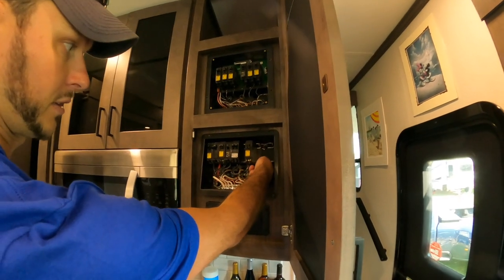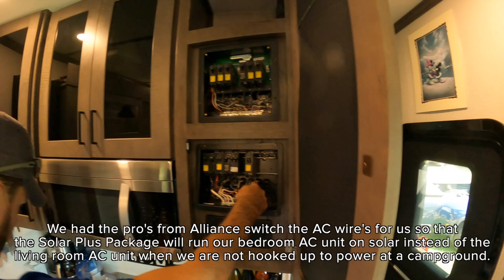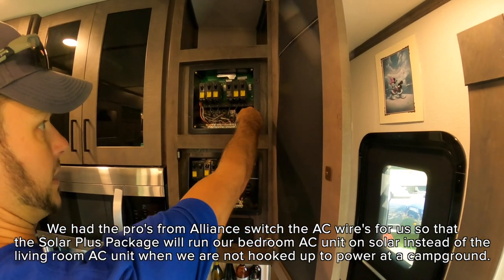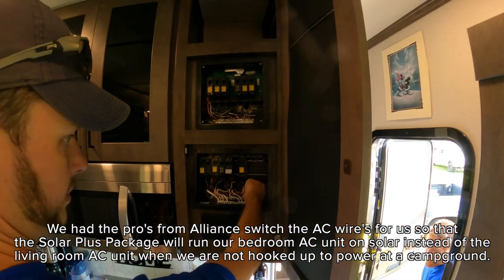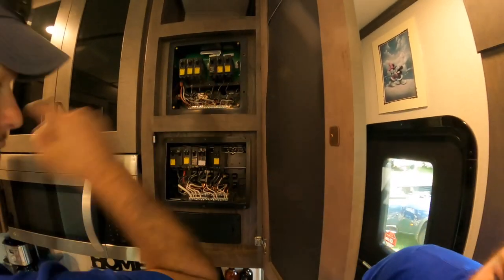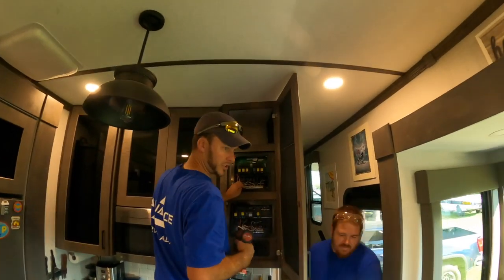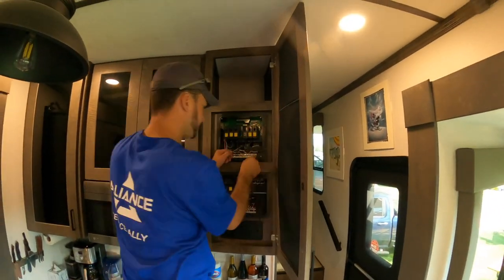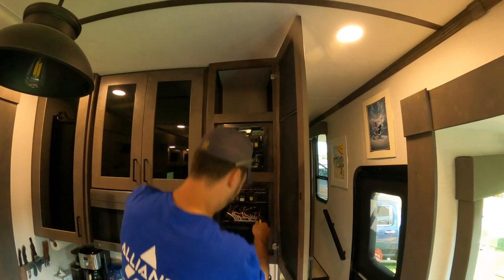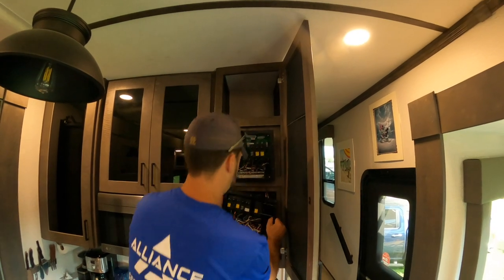This is your AC wire for your kitchen. AC2 is your front AC - the yellow coating is for the ACs. I'm taking this out, undoing these for the 20 amp, switching it to the other one. We're crossing the wires so this will come up here and that'll go down there. We turned off all the power - the 3000 watt inverter is off and the unit is unplugged. The only thing running should be your 12 volt through the battery.